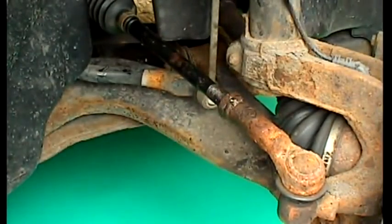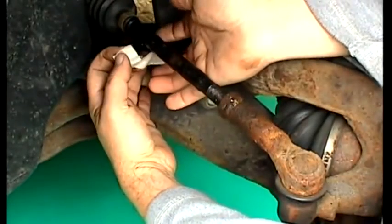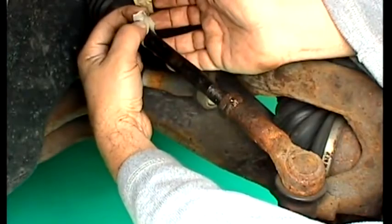It's a useful tip to apply a marker to allow turning the rods accurately — a piece of tape is adequate. We may well need to turn the rods just a quarter or an eighth of a turn when making small adjustments.